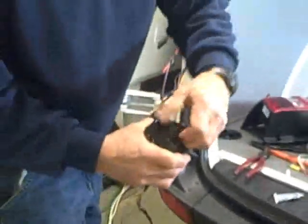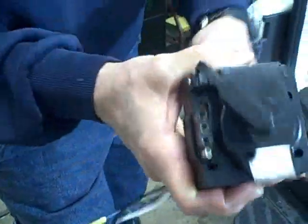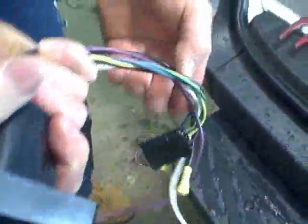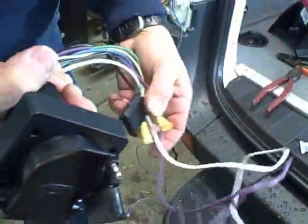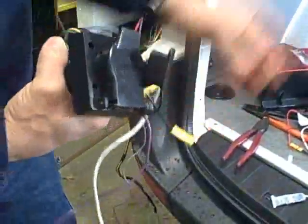This purple wire in the harness is a little longer than the rest — it's going to go all the way over to the 7-pin and 4-pin plug combination. This plugs into the converter box down below. We still have some wires to connect: heavy white going directly to chassis ground, nice clean connection; the black wire going to this plug that's going to have 12 volts back from the battery; and the blue wire is the electric brake control, which this particular van isn't getting.